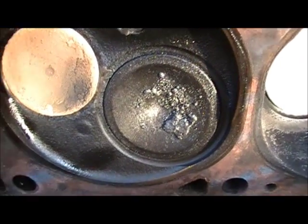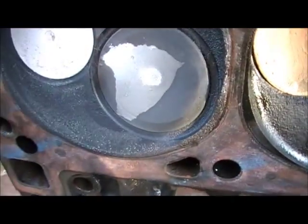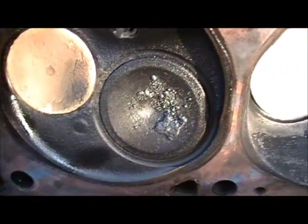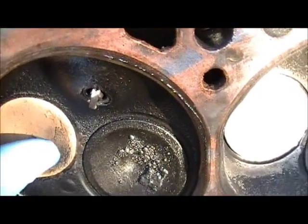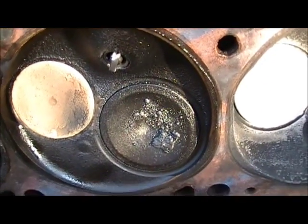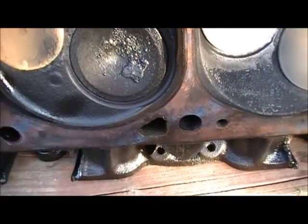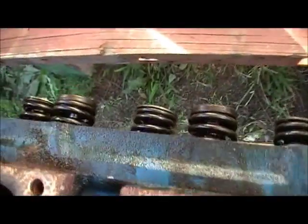Bad ignition components will cause this too, but the other cylinders look good. That was the one that wasn't contributing — this is cylinder number six. I pulled the plug and grounded it yesterday and started it, and the miss was in the same spot. So that was an indication that the miss was right there.